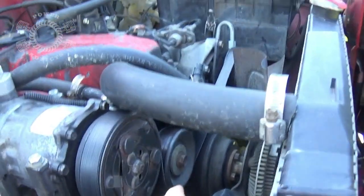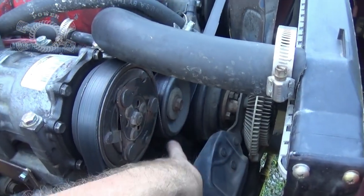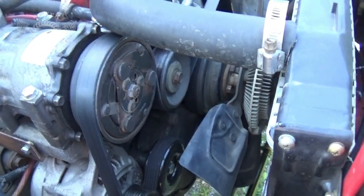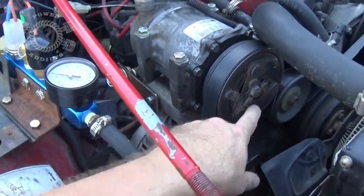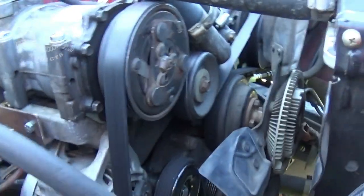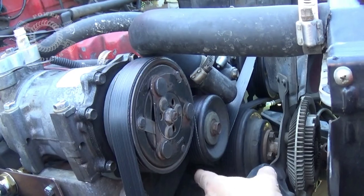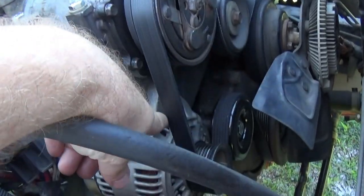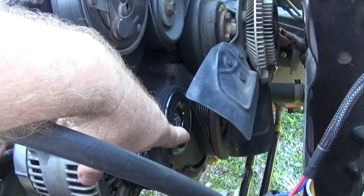Now the next video in the series will be all about setting up your belt for this. Of course, whenever you have a non-AC rig, your belt comes off the bottom of this pulley here and comes down to the alternator. Well, whenever you add the AC, that belt, I'm trying to find you guys a good camera angle here. It comes off the bottom of this factory pulley here, it'll come over the compressor, down to your alternator, then it will go down to your crank.